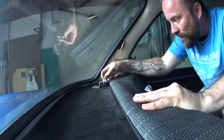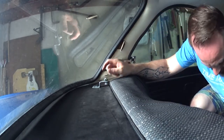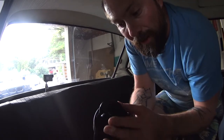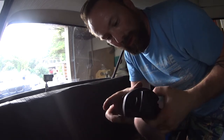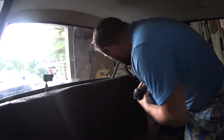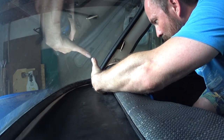I've got that nice and snug on there, and I've just put the bolt in so I wouldn't have to wiggle it and I can just hold it and put the inertia reel back on. So now I've got the inertia reel, and this is pretty cool from Securon — it's got this adjustable portion to it, so you can install this reel vertical or horizontal. You just got to make sure this arrow is pointing up and you'll get a nice action out of it. I'm going to slide everything on.